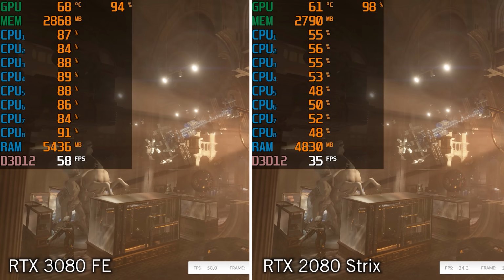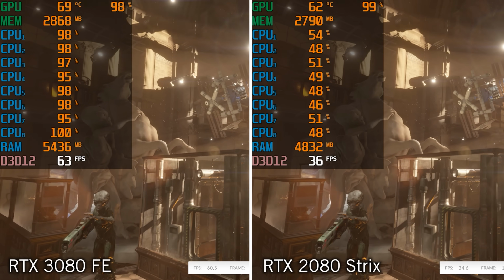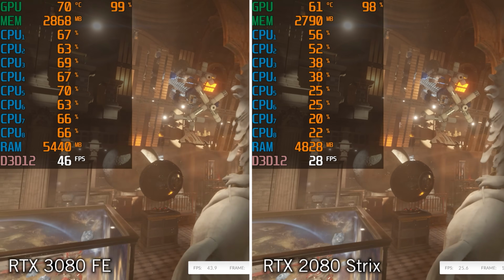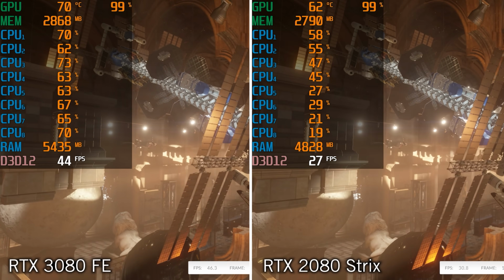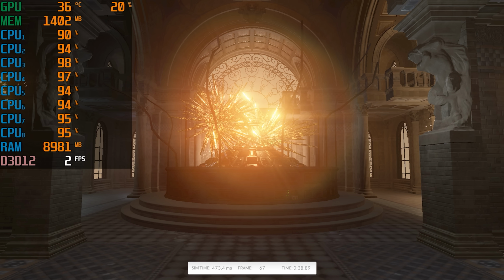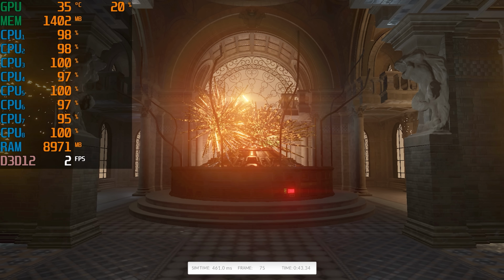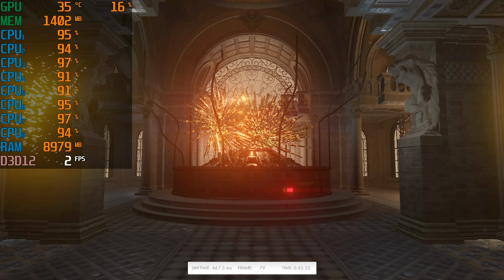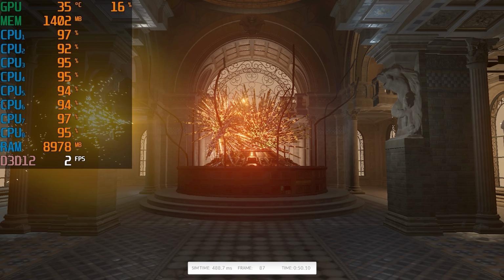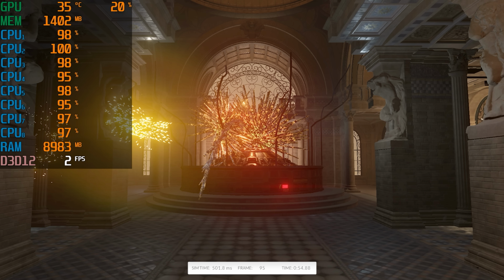This particular section of the Time Spy Extreme test leverages the GPU, hence the high percent usage up top for each run. This means the CPU will have little impact on our frame rate, though we can see increased usage on the RTX 3080 side on account of the card's ability to render additional frames per second. That said, the CPU heavy test you're seeing here is absolutely horrid for the FX processor, shoving out 1 frame every 500 milliseconds or 2 FPS, 2 frames per second. You just multiply that by 2. And it stayed like this the entire time.